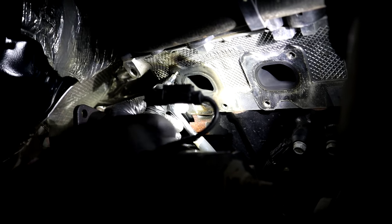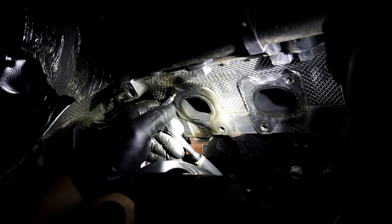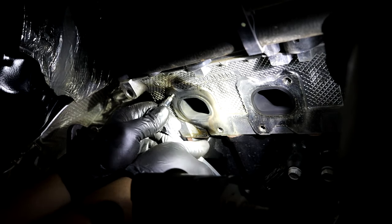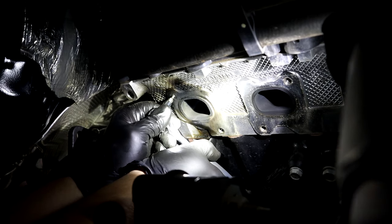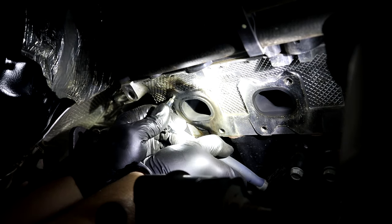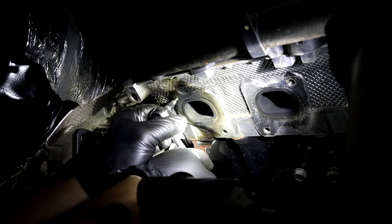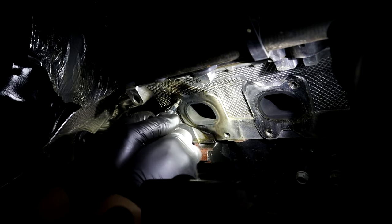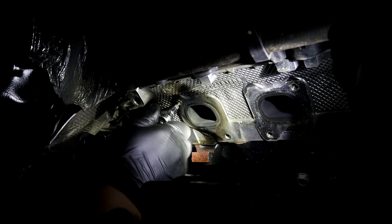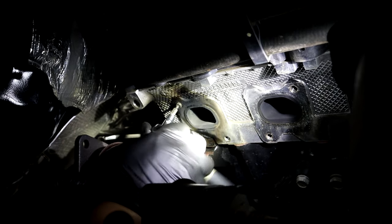All right, we ended up having to change out the extractor bit for a different one. This one actually seems to be working, and I'm using my little quarter inch ratchet to get it out. But once I hammer in the bit, if we turn the ratchet, take our time, you can see the broken bolt is turning and is coming out. And we are just breaking the surface now, so we are good. The scary part's over with. Now it's all simple stuff.